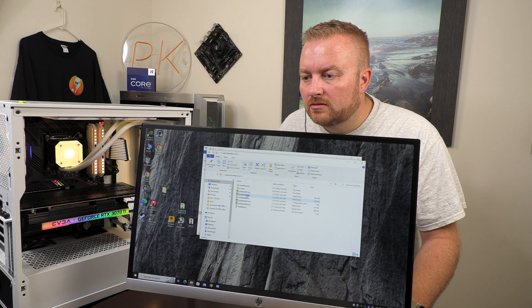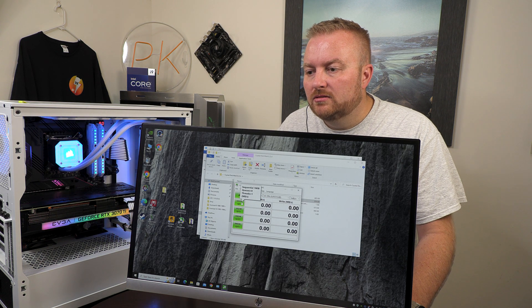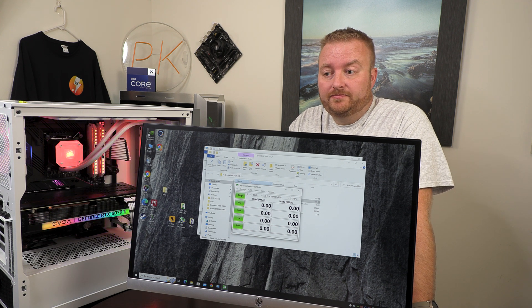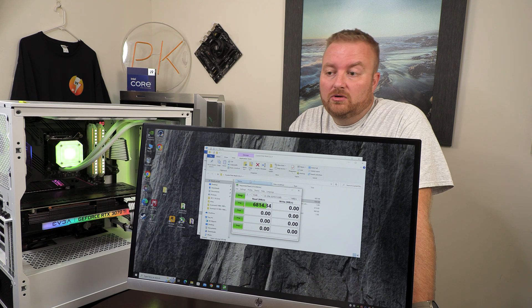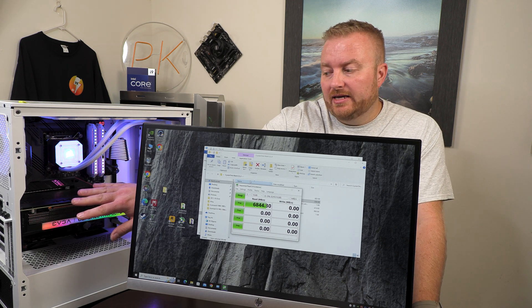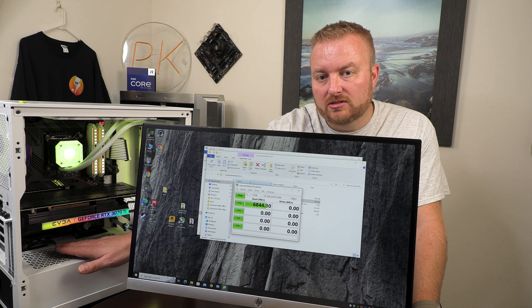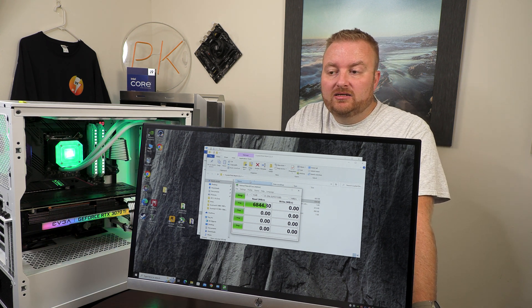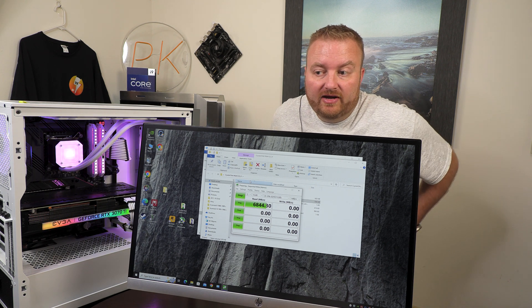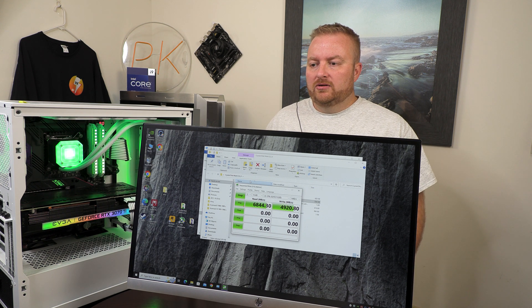Let's start CrystalDisk. We're going to check the drive — we're either going to see about 3,500 or closer to 7,000. There's our answer. Now, if you don't want to run your graphics card at potentially half its capability, put this type of unit in your lowest slot. I have three by-16 slots and it will run at Gen 3 speeds, so you'll see about 3,500 — which is still plenty fast for transferring files, playing games, doing whatever.